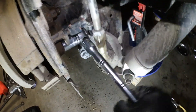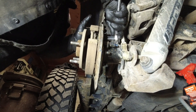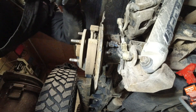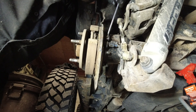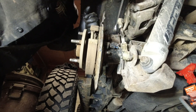I did put some rust lubricant on these to loosen them up, and I like to do these all by hand for the simple fact that these studs are just pressed in — if you strip them out you're going to be hating life. Because of the sway bar link, I like to bust that one free with a ratchet and then take it off. If you've never had that sway bar off before and you live in a rusty climate, you may end up with more work than you want. The other three come off with the ratchet pretty easy; just this one takes a little more time.